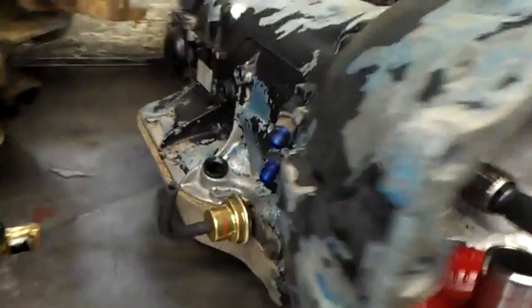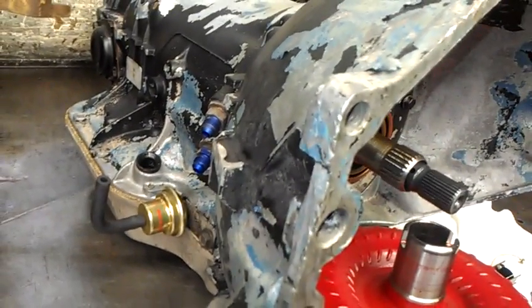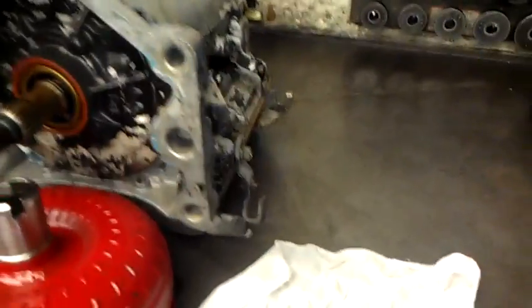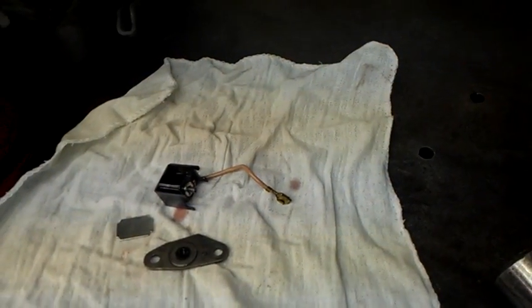Also, make sure that your vacuum is connected and that your vacuum line is not restricted with carbon. If it is, just clean it out. Alright guys, so Turbo Hydromatic 400 — just in case yours won't upshift, this is one probable cause: the kick down switch. Thanks for watching.